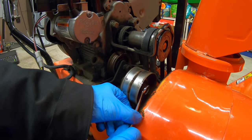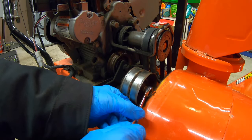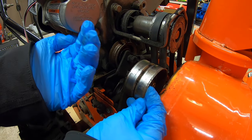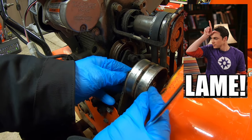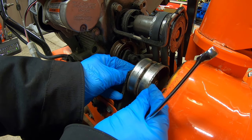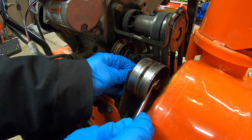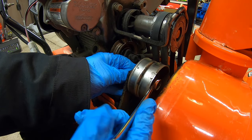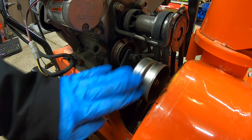Press down just like that and give it a few turns. You don't need to take it out all the way because all we need to do is slide it on that track. As predicted, this tensioner was set all the way back, so it was barely applying any tension. What I'm going to do is push it forward about a quarter of an inch on that track and then simply tighten it down. All set — now with a bit more tension.